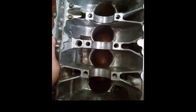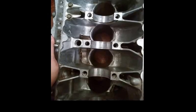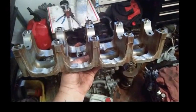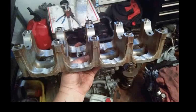The motor made incredible power with a pretty basic setup. It's AC friendly, so it's a little shitty log manifold and a Turbonetics turbo. But the turbo wasn't very big. I think it's maybe a 30R classified, a 60 trim. When they started rolling the engine on the dyno, with a 7.5 redline at 16 pounds on this little turbo, it made 330 wheel horsepower.